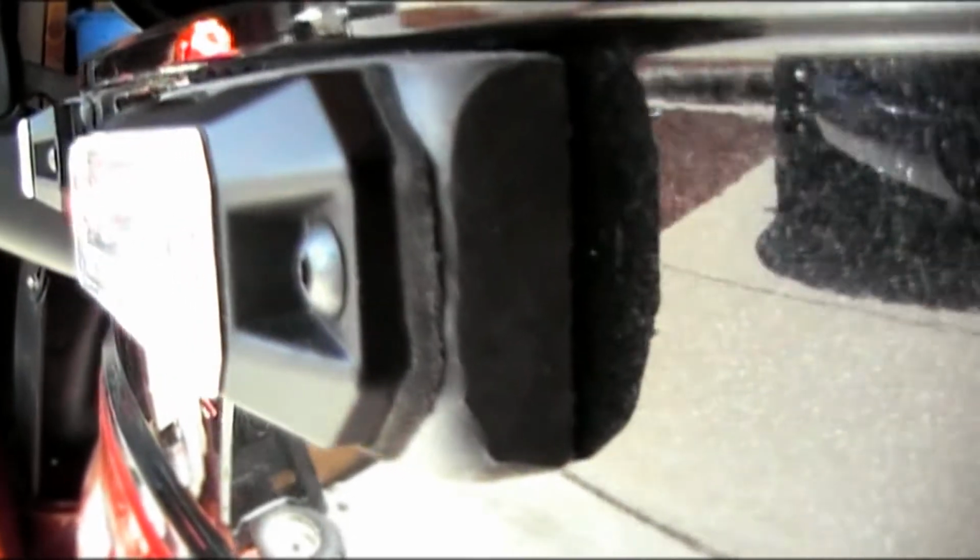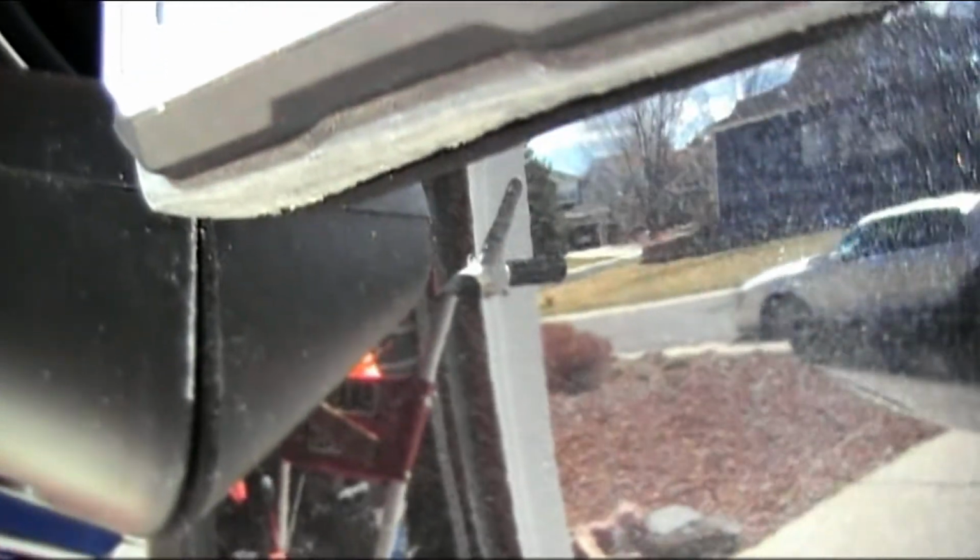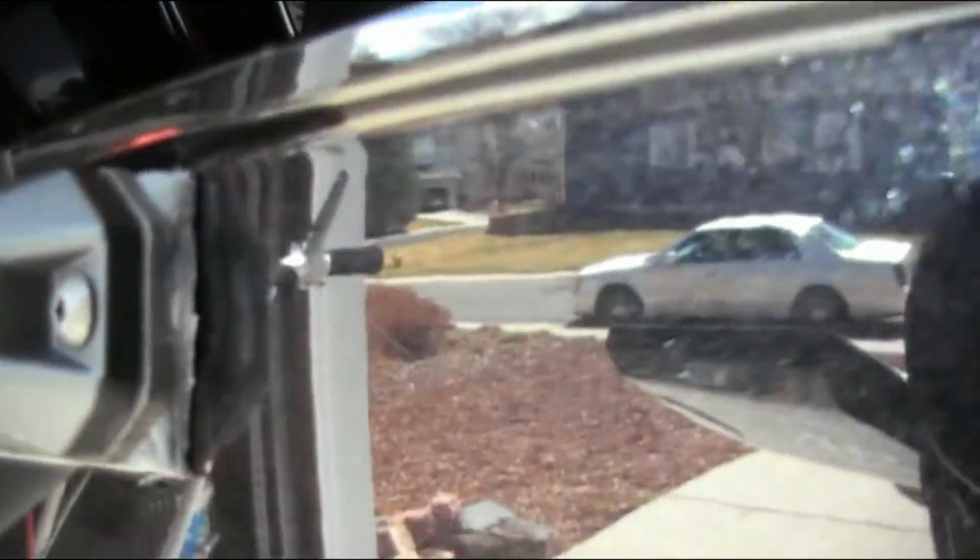So you can see here is the silicone in the final stage. When I put it in the mold, I use a release agent, which is just like a Vaseline. It was a Vaseline for skin, so it wasn't truly Vaseline. But you can see it rounds the corners a little bit when it fills in there, so it worked out well, and the silicone came out of it very easy.